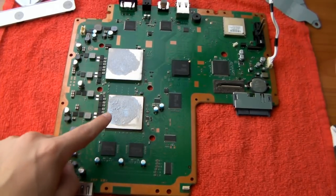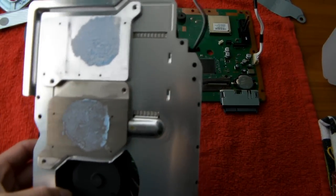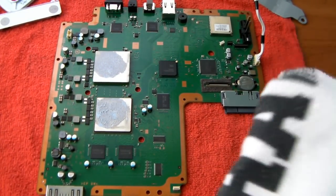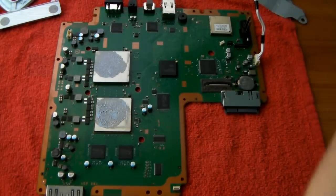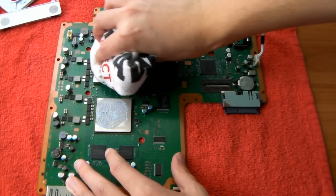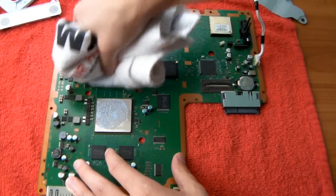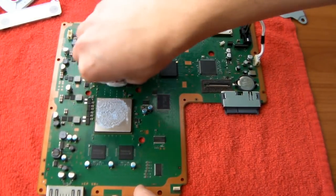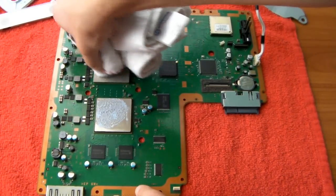As you can see, we have some compound on our CPU and RSX, and also on our heat sinks which are attached to the fan. All you've got to do is take some rubbing alcohol, get a little bit on the cloth, and rub it onto your CPU and RSX very thoroughly — get all of it off. Just a note: why would you want to replace it? Well, Sony does an absolutely horrible job of applying thermal paste and uses very cheap thermal paste as well, so it does not transfer heat very efficiently and will probably result in the yellow light of death.